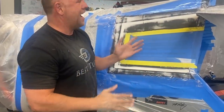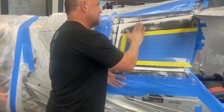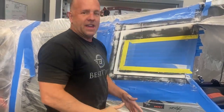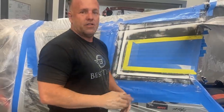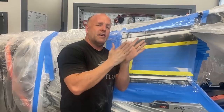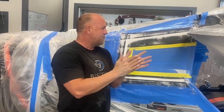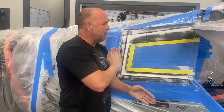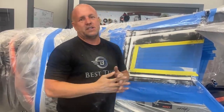And then when that's dry, I'll baste it by just kind of smearing in some resin really tight and thin. Let that get on and then lay the carbon fiber three more layers on the top. So it's micro, bodywork, and filler all at once, super lightweight and a bonding agent. Three more layers of carbon. That will take almost no bodywork. That next layer is critical.